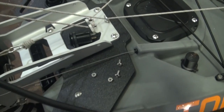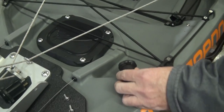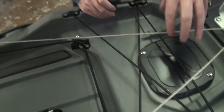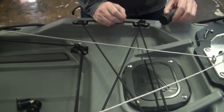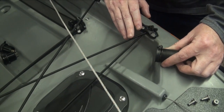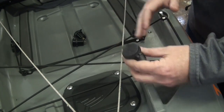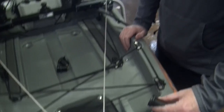So in order to power up Jeff's GoPros, we're going to be doing another waterproof USB port back here. We were debating between utilizing this panel as the mounting location or putting it on a vertical surface. Typically, I shoot for a vertical surface just for water intrusion. If it rains, this panel may catch water. On a vertical surface, you're a little bit less likely to have that.